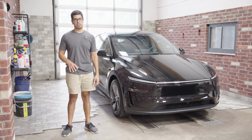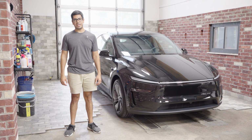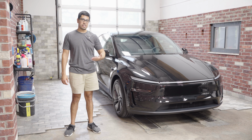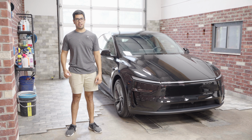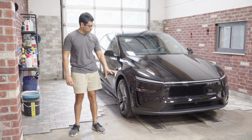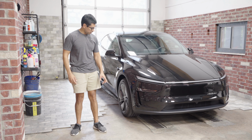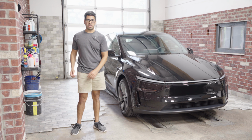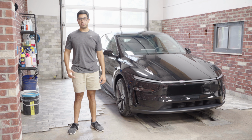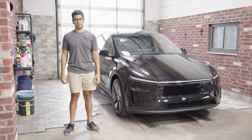This is a long-term product, so we don't want any of that contamination living under the film for the duration of the install. We also want to be extra mindful of all of the edges on the perimeter of the panels and all of the jam areas inside of the panels where we're going to be wrapping and setting film edges. On these brand new vehicles, there's usually a lot of grease and grime hidden in these areas, especially along the lower portions. That usually comes from road grime, from driving it down here to the shop, and more importantly, from the tire dressing that a lot of these new vehicles come with that gets slung down the side. So all of the contamination and residues that are present that will otherwise affect the durability and aesthetics of our install, those are the things we're looking to address by thoroughly prepping the vehicle.